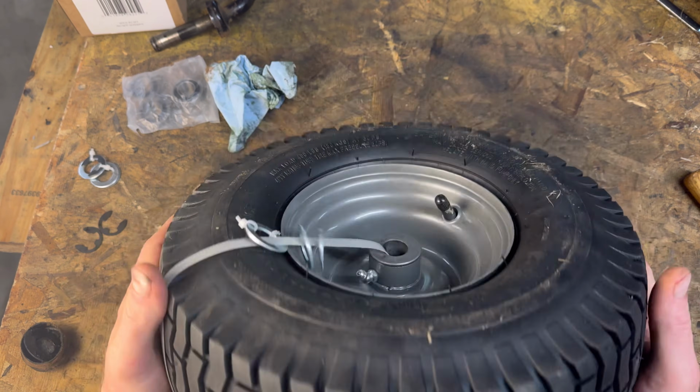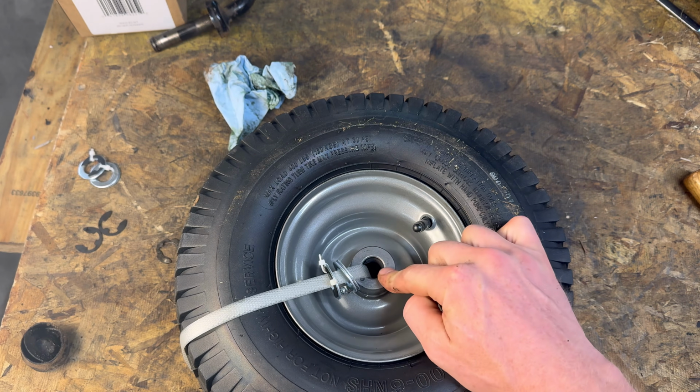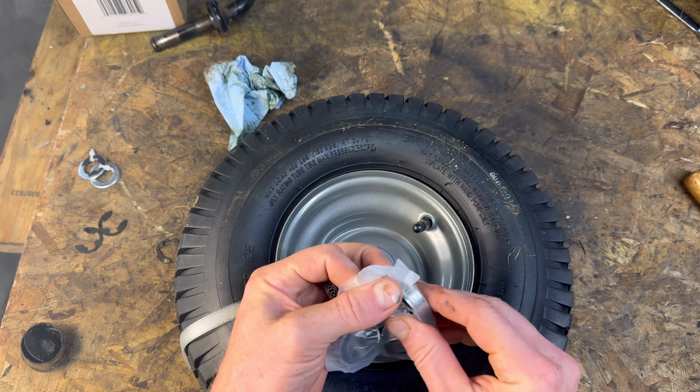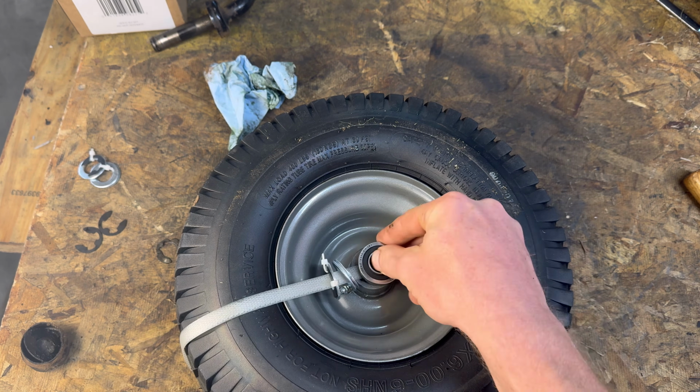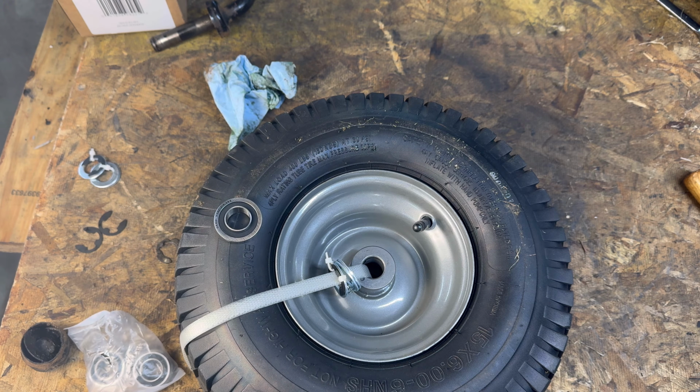So what I'm going to do, I'm going to take these and pound out these, and I'm going to upgrade the new metal bushings to actual bearings, because this is an $11 kit here, and you can actually slide in bearings, which make this thing run even better. But that's going to be a whole different video to talk about replacing bushings with bearings, and we're going to talk about the different types of bushings, which I'll put a link below.